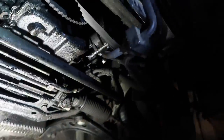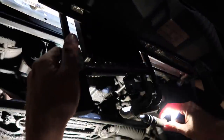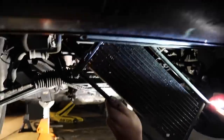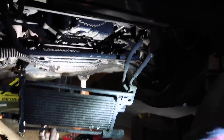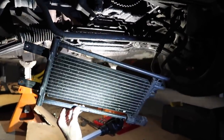Blake removed two screws up top for the transmission cooler. Down below this is the actual cooler itself — took out four little 8mm screws. Here are the lines that go all the way to the trans. It snakes right out of there. That's one more thing we're happy to delete — saves some weight. It could actually make a cool oil cooler repurposed, but we'll pass on that.